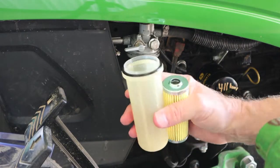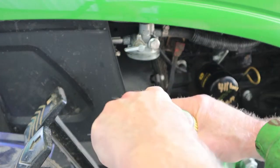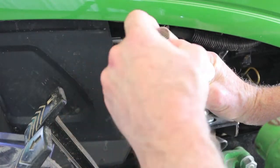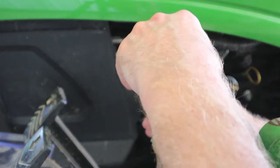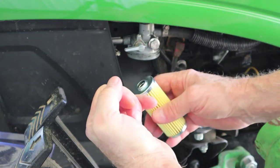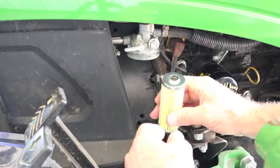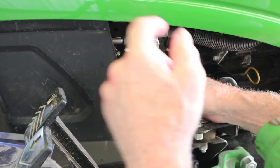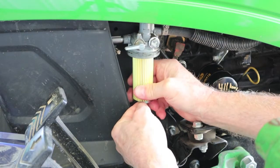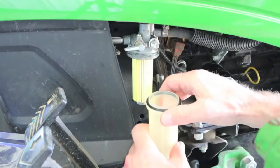Our parts are cleaned up. This has been rinsed out with diesel fuel twice and cleaned. I'm going to use the same old ring — it's in really good shape. Drop the indicator. There is a stem in the bottom of this and the spring just goes around it — it keeps the spring from getting too cockeyed. I'm going to put a little bit of diesel fuel on my finger and get it on that O-ring. There is a small O-ring up in there. That was a good firm snap to get it up there. I'd like to have that spring dead centered, but that ain't going to happen.